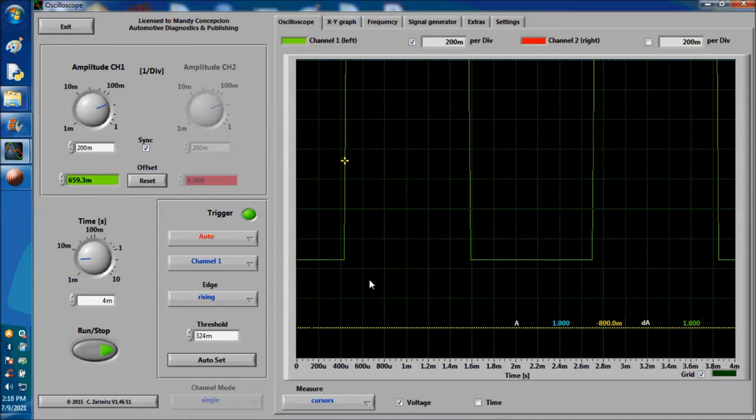Anyhow, going back to this thing here, this is an issue. You have to test the wires, make sure that everybody's on the same plane. You may want to check all your ECM grounds, even if that takes a long time, but that's just the way it is. That's why it's called diagnostics. And you should be charging, some parts of the country are charging $150 per diagnostic, somewhere around 120 is the norm. In a poorer state, you charge at least $85, because you're going to spend time doing this and you should be compensated for it.